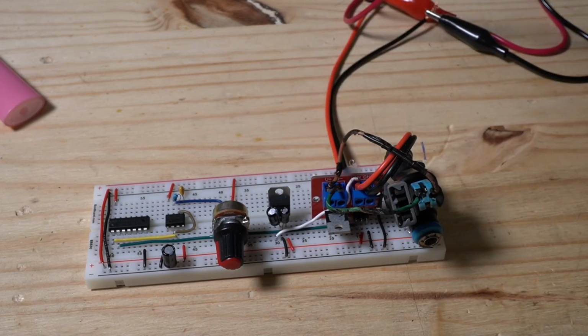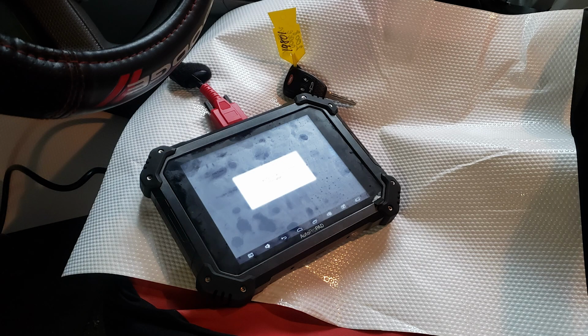Like I said, I was happy to clean it up. Today started out with a 2008 Dodge Avenger. We had to cut and program a new key. This vehicle was setting a P0513 SKIM code. I think it's SKIM key code invalid. And also the vehicle wouldn't start. I don't believe it would crank either. So the technician diagnosed it properly. We cut the key, programmed it, and we were good to go there.